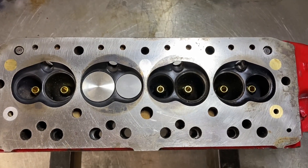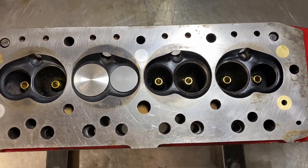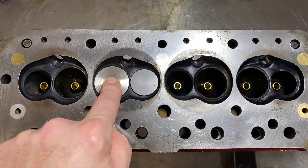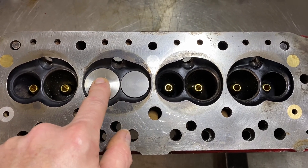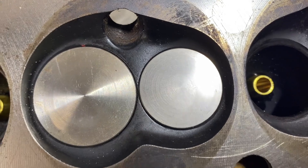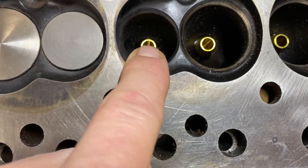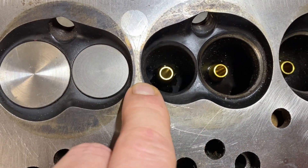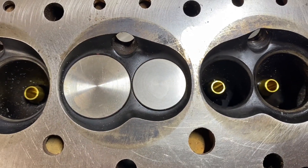So this is the head face. These valves, as well as being inclined, are actually offset further apart — this is a 37 inlet and a 31 exhaust, or 37.5 inlet and 31 exhaust. You can see there's still a gap between them, and insets have been put in to move the exhaust valve guides over and away from the inlet so there's more space for those valves.